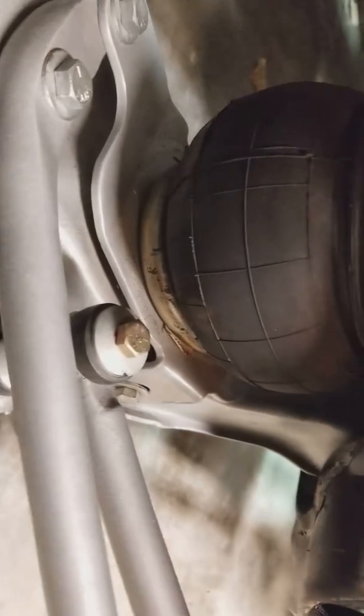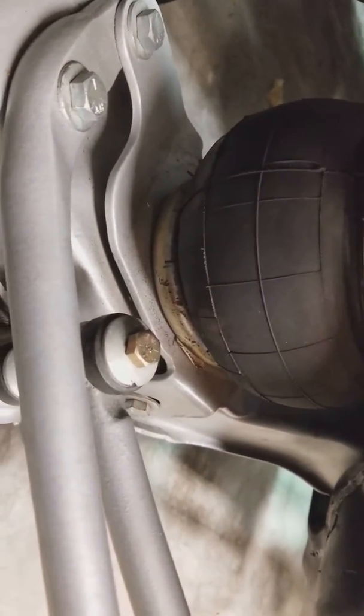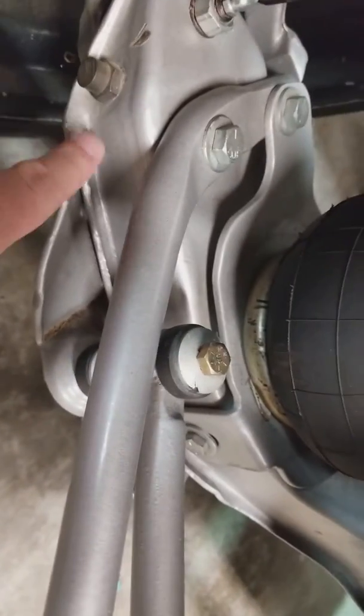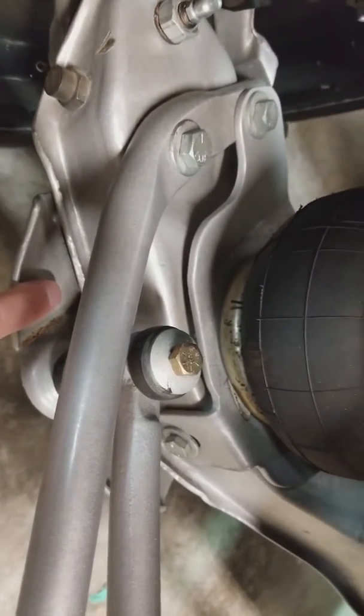You can kind of see up here at the top of the bag where that's at — see the top cup there, connected to the airbag right there. That's your top cup, that's the airbag. So that's the bracket that you'd have to make to go up in the top spring. This is actually a Firestone Air Ride Technologies bracket kit for this type of suspension without the wishbone.